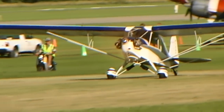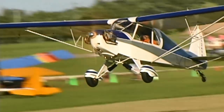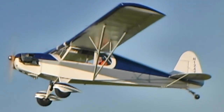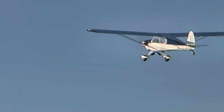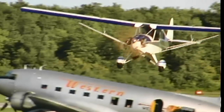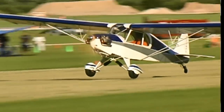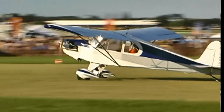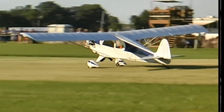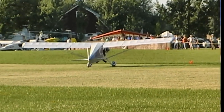Bob, there was something else. Doesn't this have a folding wing? Yes, the wings fold. It's probably the easiest system on the market to fold. We fold an inboard flap under. By the way, this has operable flaps also. We fold the inboard flap section under. We disconnect the fuel line. We're going to need a couple of guys to do this, or no, one person? No, one person can do it. Pull one bolt, and the wing folds. It takes about a minute to the side. And in 10 minutes, I can have this thing on a trailer and hiking down the road towards a show.